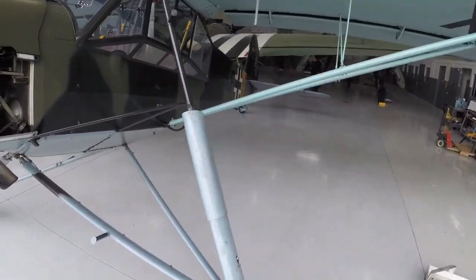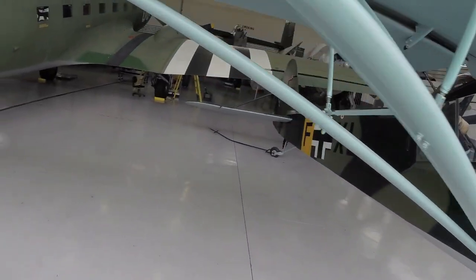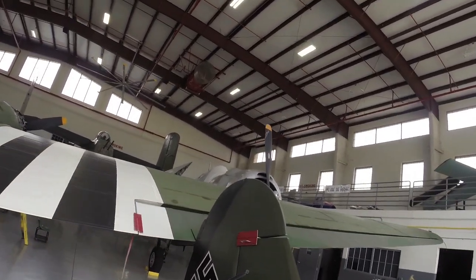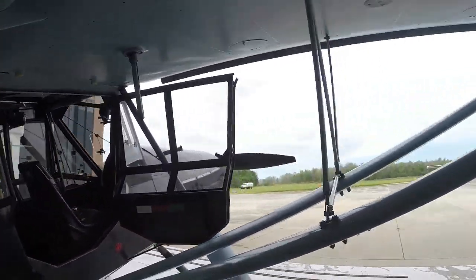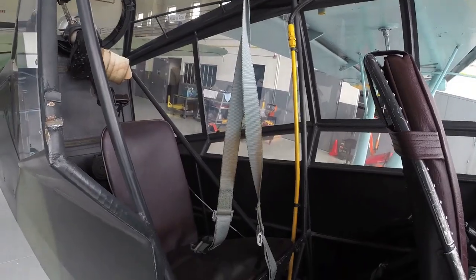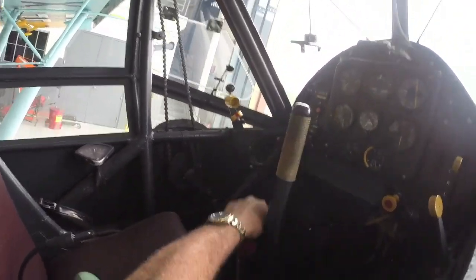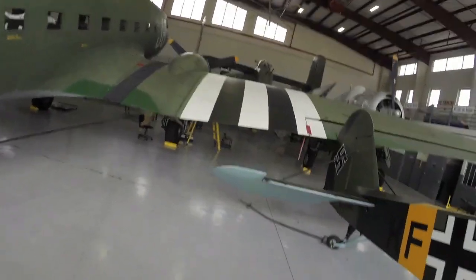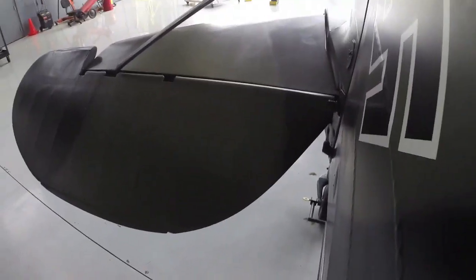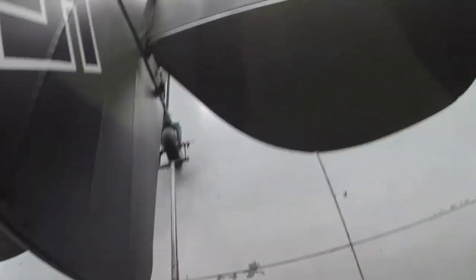Okay, that's all good. We're going to get rid of the chocks — don't need those anymore. One of the things I can do is I can actually fly this thing, get it in and out of the hangar myself. Get rid of that rudder lock — we usually stow that back here — and also get rid of the elevator lock, which is under there. Pull the stick back a little bit and disconnect that. Now the controls are free and I can just push it out myself with my little bar. Sometimes I've got to get it rocking.